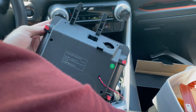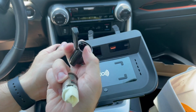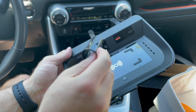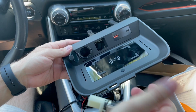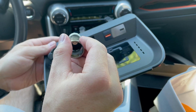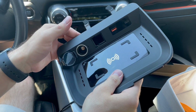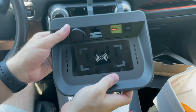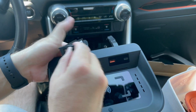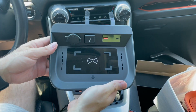We will transfer these USB ports and barrel onto here. So just like the way we removed it, we're going to install this guy first. You can see a groove in here, which is for this section. It will align quite well. So that's installed. Then we'll take this, we'll align this as well to get this installed. Then we'll push it in until it clicks inside. So that's completed. We'll take the USB port next, and we will slide this inside of here until that clicks.